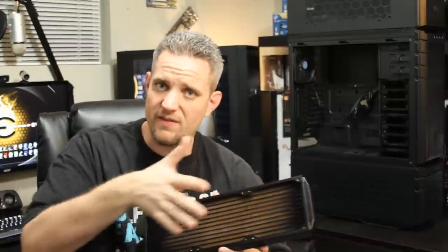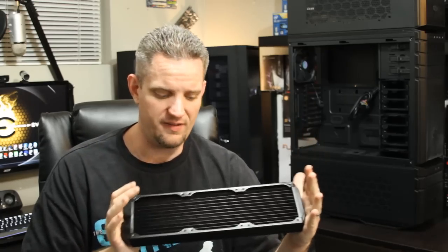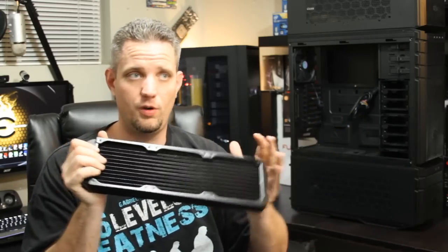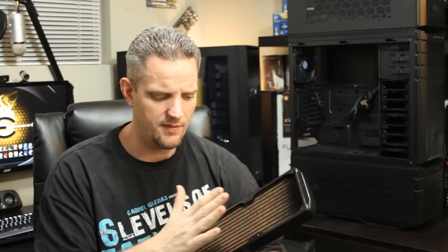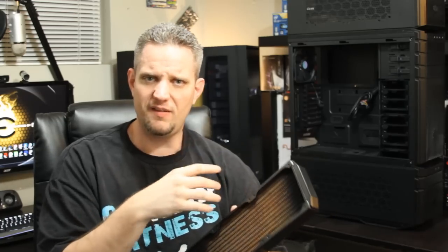It's not just about the number of fans — this core part matters the most. Higher FPI means more fins for smaller radiator setups. But the downside of high FPI radiators is that they are more noisy, because there's more restriction for air to get through. It creates turbulence because the air off a fan naturally comes out sideways at about a 45-degree angle, but the fins force that air back to straight and it gets very turbulent — the air is bouncing around in there and it just gets noisy.